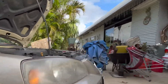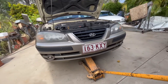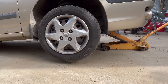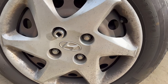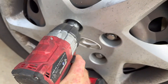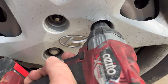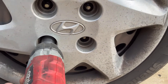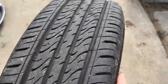We'll get the wheels off because that's where the brake pads are - behind the wheels. We do the front first. If you don't have a rattle gun you'll need to crack the wheel nuts before you jack the car up, but we have a rattle gun so we'll just rattle gun the wheel nuts off. With an impact gun, the less extension bar in front of it, the more chance you'll have of undoing it. Also a good opportunity to inspect the tire when you take it off.